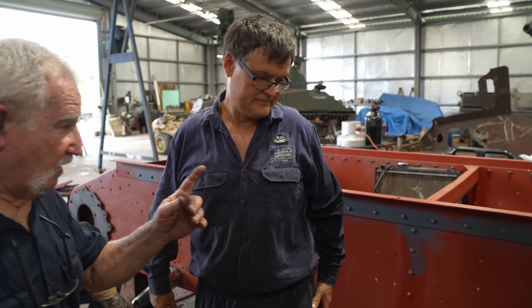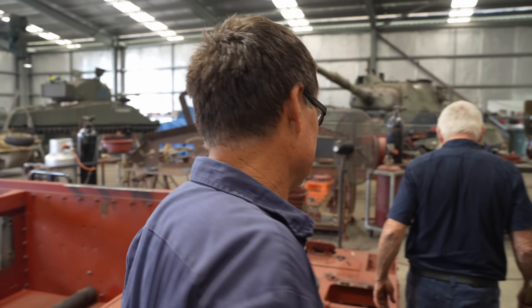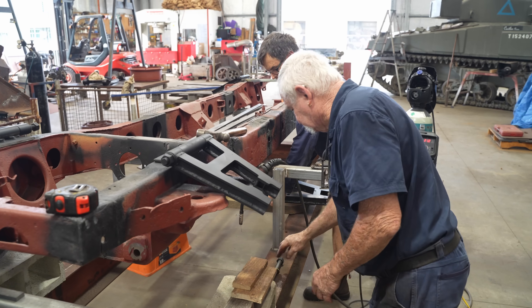This is the bottom bolt that holds the whole system onto the main A-arm down the bottom. It just fits inside there with a 22mm nut on the bottom which will screw into the A-arm. Once I put on the little brackets, the rest will assemble when we do the final assembling, because we don't need the brake drum on at this stage — it's only just adding weight to the job and it's too hard to handle. Better to do it once right — do it smarter not harder. John couldn't make it in today but luckily Daryl's always ready to lend a hand.